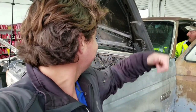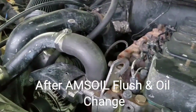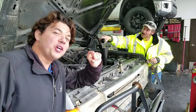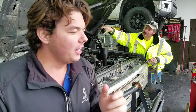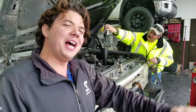Before we do this oil change, we're actually going to do a flush. Matt's going to go ahead and dump it in. This is a very thin detergent and basically what it does is it breaks down the oil and gets all the sludge out of any oil passages. It also cleans up around the pistons, cleans up valves, all kinds of stickiness — gets the gunk out of there. We're going to idle it for 15 minutes and then we drain her.